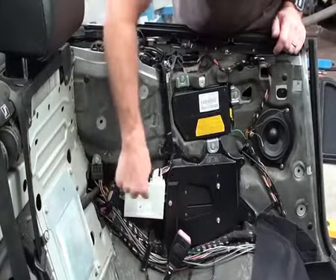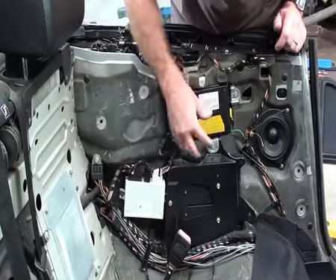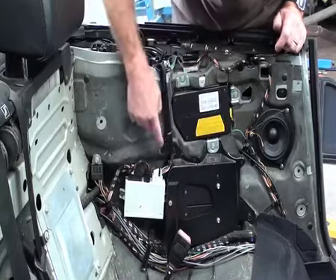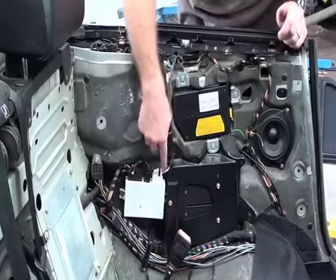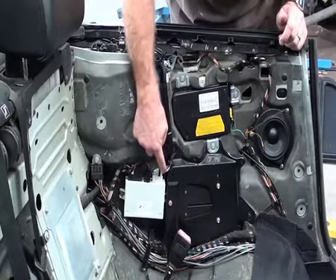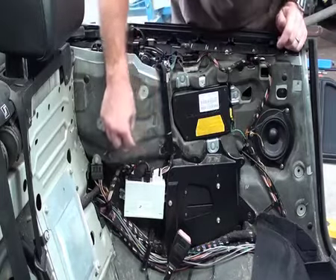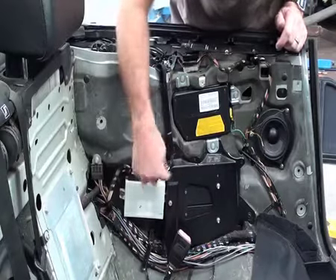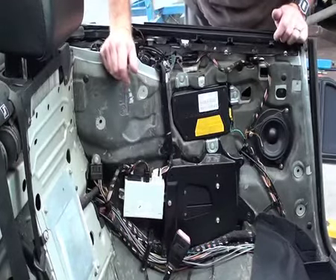Once you're here, there's the convertible module here, and that's the airbag. I think I put it on a line that you actually need to remove that — that's incorrect. The line that has the wires that normally break and the harness that actually goes to the front of the car, to where it latches to the windscreen, comes through this line here. So to test the continuity, you would actually just disconnect that plug there, and then you can check that with continuity with the wires at the front.